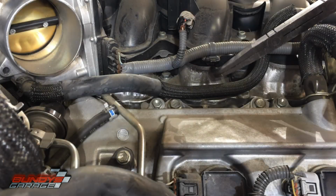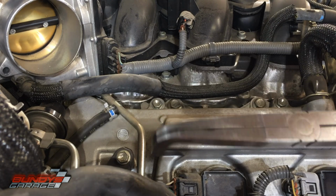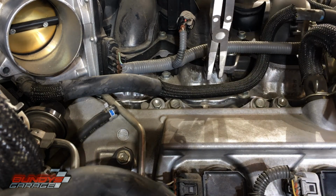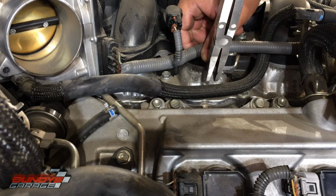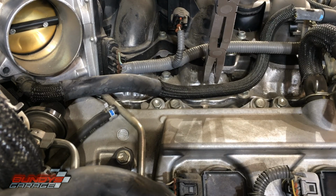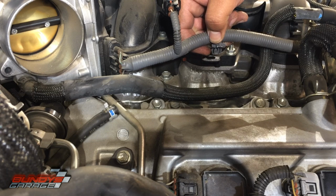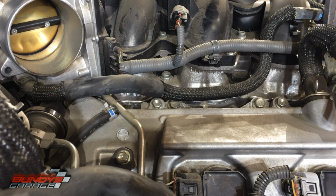Okay, so to help me get these clips out, I have some pliers that are at a 90-degree angle. I'll put a link in the description below to some pliers like this on Amazon. Crescent sells these. I actually bought these from Sears before they closed down. Just coming down in here, you have 2 little clips that you have to squeeze together to get it up and out. So let me see if I can squeeze them. Okay. Yep, see? So right there. You have these 2 little clips that need to be squeezed together at the same time. So just came down here, squeezed them together, got them loose.